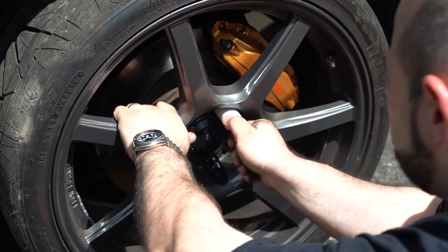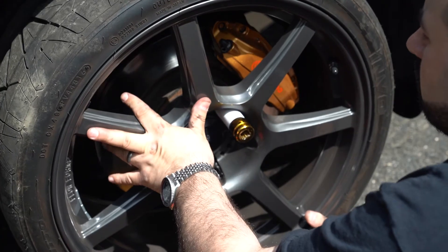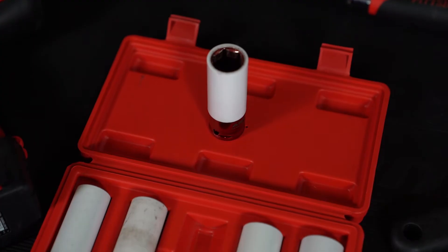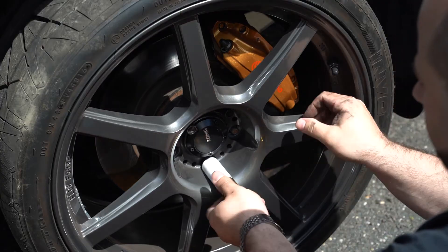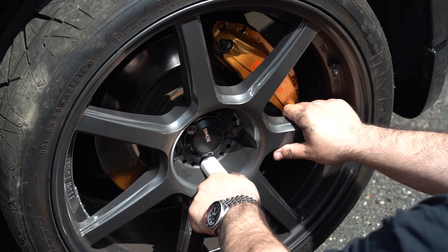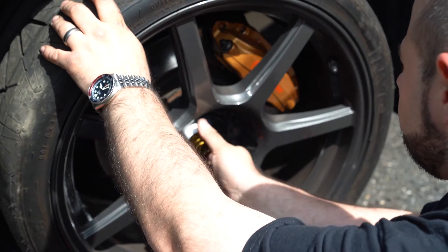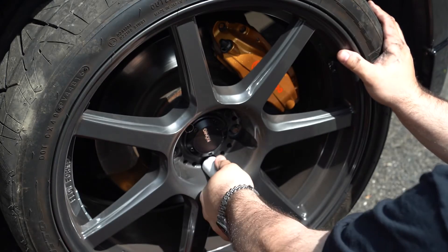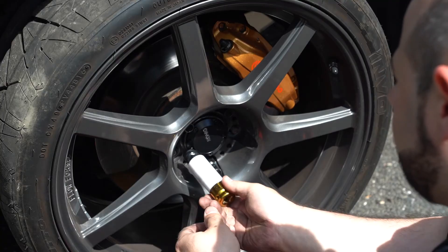Now that we're going to get this wheel and tire package fitted onto the car, we're going to lightly, by hand, get the first couple of lug nuts started. You'll want to use this nylon-coated socket — it keeps you from scratching the wheel. Before ever using a torque wrench, we want to make sure we're hand tight. This is a five-lug wheel, so we're going to work in a star pattern. Once they're hand tight, not only is the hub ring going to make sure it's hub centric, but hand-tightening in a star pattern lets the whole pattern shift so the lug seats are perfectly centered and seated — avoiding any issues where the wheel isn't perfectly hub centric.